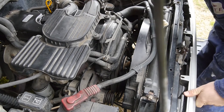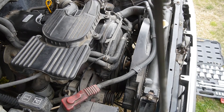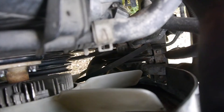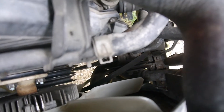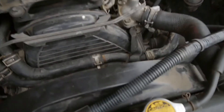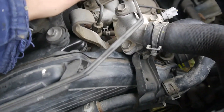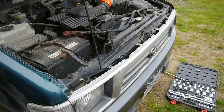I might just take the power steering pump off as well, just to see what noise it does make without it going — or lack of noise. Just pulled the power steering belt off as well, so now we've got no accessories. We'll just see what that sounds like. So that sounds pretty good. I don't think it's anything off the water pump — it sounds the same running or not running.